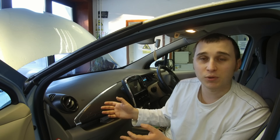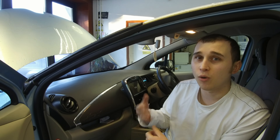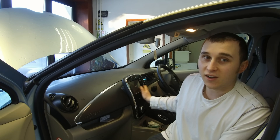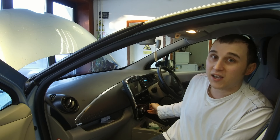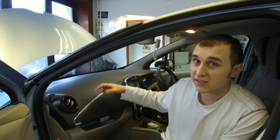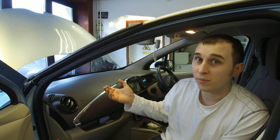If you're going away on holiday, what I'd advise you to do is plug your car in and leave it plugged in to 100%, and maybe set a charge schedule so it's not always constantly charging. Maybe set a charge schedule where it just pops on for an hour or half an hour's charge while you're away. The way to look after it from abroad and make sure the 12-volt stays up is to set the charging schedule so it only comes on for an hour at night, but every now and again have the preheat kick in for 15 minutes. As I've said in my preheat video, you press this button, you select a time, and the preheat will kick in. So if you have the preheat kick in for those 15 minutes that you've got the charge schedule running, that'll wake the car up — and since it'll be plugged in and charging, you won't lose any battery charge, and that will check your 12-volt battery and top it up. You can set that to come on every day or every two days.